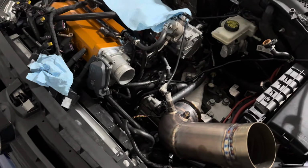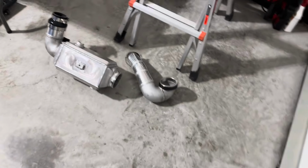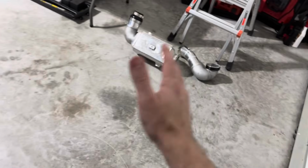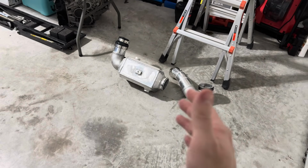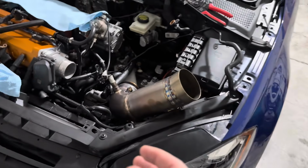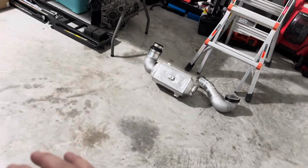The cooling difference between the two, the rise over run on water and ice only, that's no salt, just water ice, on 30 PSI between 60 to 160 was a 40-degree intake IAT rise over the run. It started at about 65 and went to about 100 to 110, which is a little too much for what I was kind of hoping for. It's still better than air-to-air, 100%, hands down.